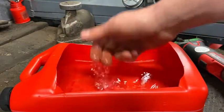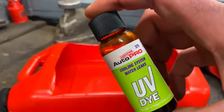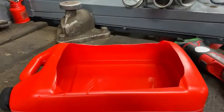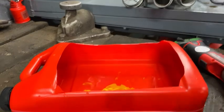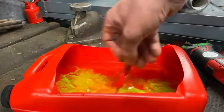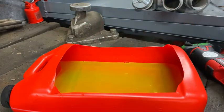What we've got here is some Alabama tap water — that's what keeps me hydrated. I've got maybe half a gallon of water here, and I'm going to put a very, very small amount of this dye — maybe four or five drops — into it. As you can see, there's a lot more than four or five drops in this bottle, but I want to show you how powerful this stuff is. There's one good-sized drop. Look at that — automatically you can see the color. If we simulated running your car for a bit and mixing it up, look at the color of that water. You can see it's really bright. If you have a leak getting on your driveway, that's going to catch your eye right away as opposed to just a little bit of water.